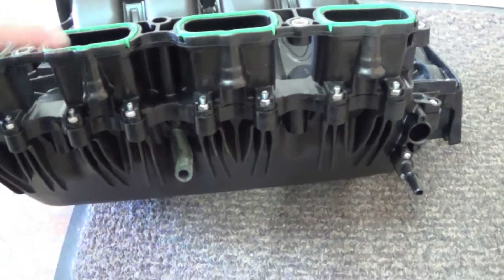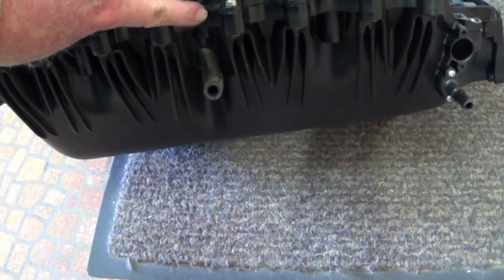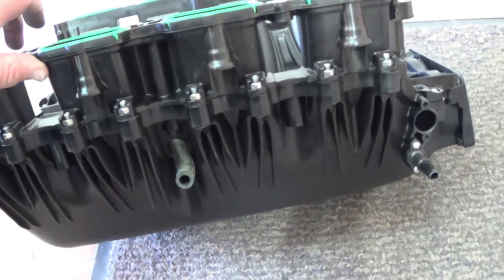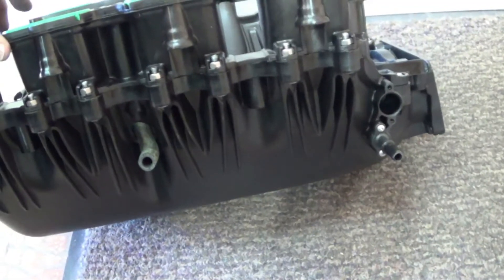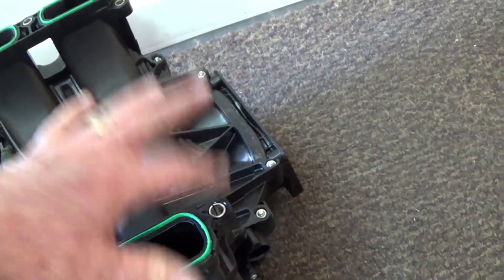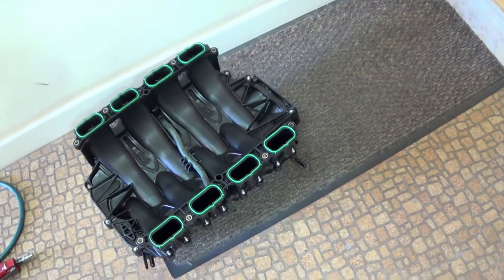While this was on the bench I did get a little hasty - I'm assuming that these bolts, since this is a plastic weld along here, are in here for pressure reinforcement in case you pressurize the intake manifold. They don't do much else but anyway they're all tightened down. I also put these two vacuum nipples on here, but reading the instructions you need to take one off to access a bolt once you get it upside down on there, so I took it off.